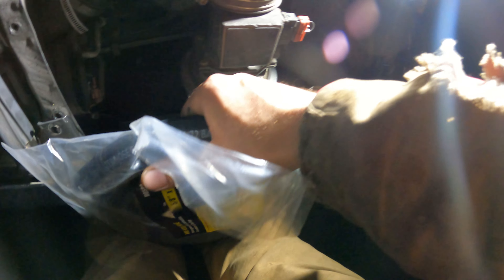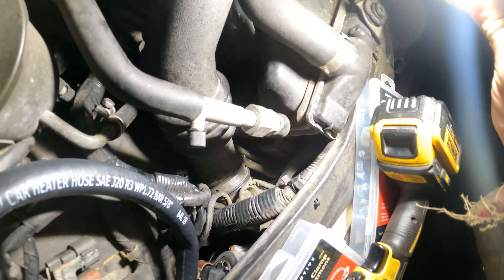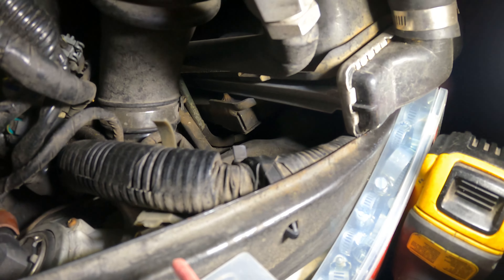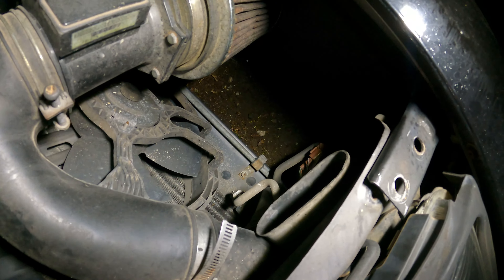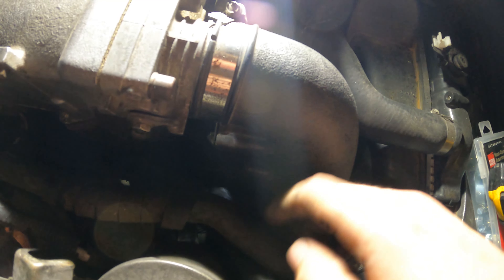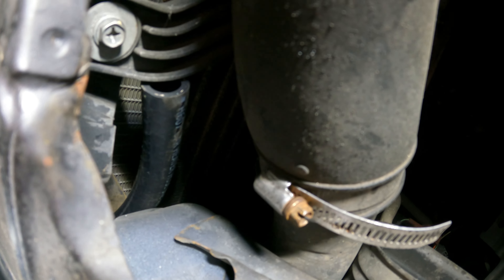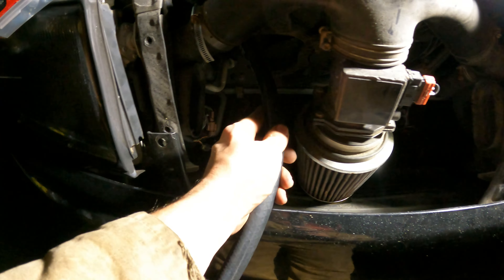Next, pull your nose panel off so you can get access. Down in your front intake air box area, open some of your 5/8 heater hose. Probably the easiest way is to take your heater hose, put it up here on this pipe, then route it down here beside your radiator and out towards the front in front of the condenser. I like my work to be symmetrical, so after I put it on I'll take it off to measure it and cut the next hose the same size.